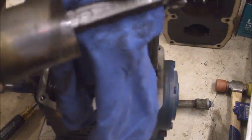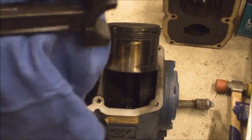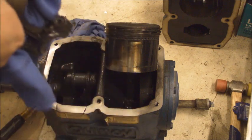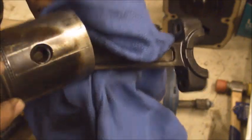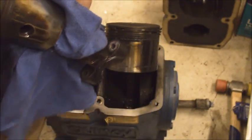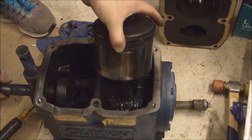After taking a look at the connecting rod, you can definitely tell that this thing was very hot at one point — maybe that's why it failed. There's a decent amount of scoring on here. I'll see if there's a bushing in here; if not, I'll look into a new connecting rod. But I don't think this is really the problem because it still moves freely on the crankshaft. I still think it's okay but I definitely want to clean it up before I reassemble.